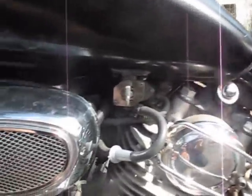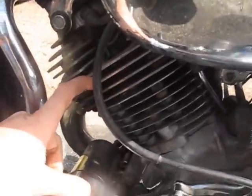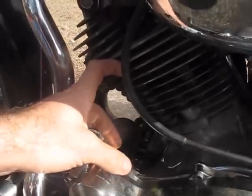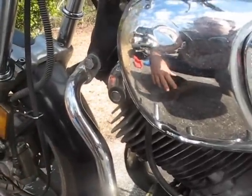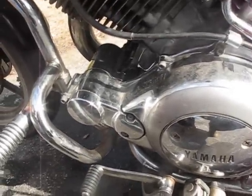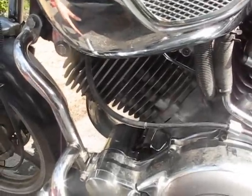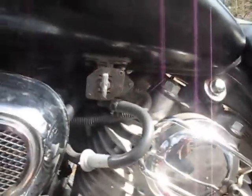This is a problem for a number of reasons. First off, on this bike — which is a '93 Virago 750 — it's only leaking into one of the cylinders, so you get almost like a puddle of gas in there. When I start it up, it fouls out these plugs. So I'll get one plug that fouls out pretty regularly. Another problem is it will actually dilute my oil and make it really thin, so my oil won't lubricate the cylinders and the pistons like it should, and that can wear out my engine really, really quick.